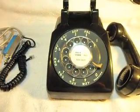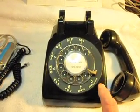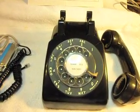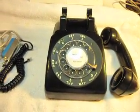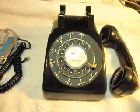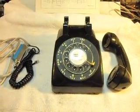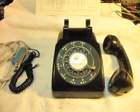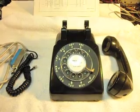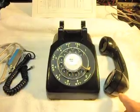We'll get a modular port installed in this phone — put it inside the telephone so that once the modular line cord runs out of the back of the phone, if he ever has a problem with it down the road, he can simply open the phone and plug in a new black modular line cord. He won't have to do any major repair — he can just open it up, unplug it, and plug a new one in. He's already set up for modular at the handset and at the side of the telephone.